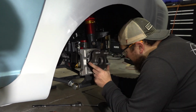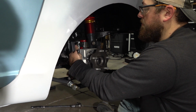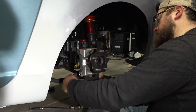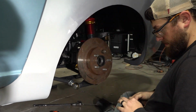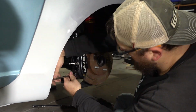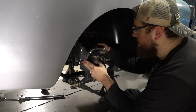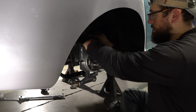I wanted to mention, if you're doing anything similar to this, to be careful when purchasing wheel bearings. Most parts stores, AutoZone, Advance, whatever, have the same wheel bearing part number for a 240SX, an NA or twin turbo 300ZX, and an Infiniti Q45. This is incorrect. The Q45 and 300ZX twin turbo actually use a stronger 32 spline, 32.5mm hub versus the 30mm, 29 spline hub found in the S13, S14, and NA 300ZX. Be sure you have the right axles before having them shortened, and be sure to have the wheel bearings that match the axles and hubs you're actually using. You'll know right away if the wheel bearing is too small for the hub you're using because it won't press into place without crushing the bearing.